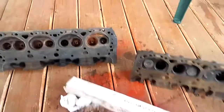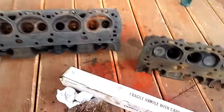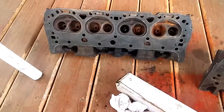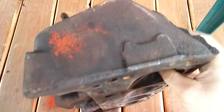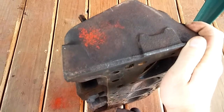Welcome back to another BAEA 66 Chevelle video. I'm gonna show you all the difference between the hardened seat like we got over here versus the non-hardened seats. Now this head right here, a lot of people know out there, this is just the old double hump head. It's got this double hump right here. Some people call them camel humps — same thing.